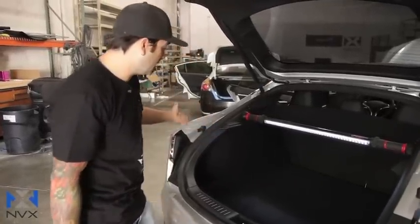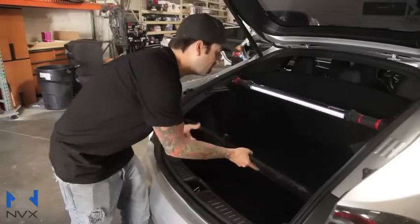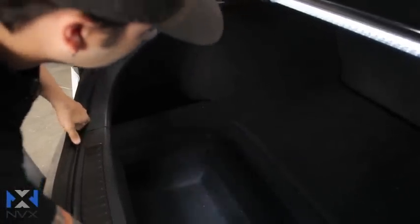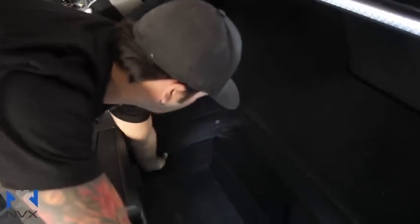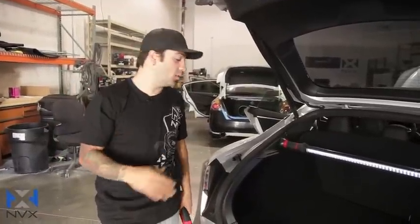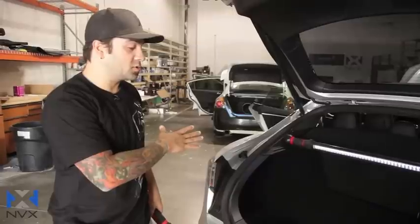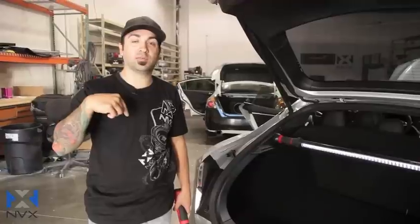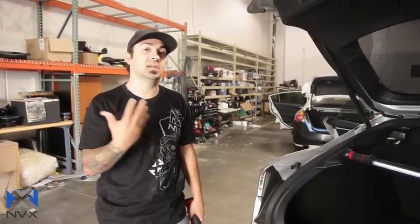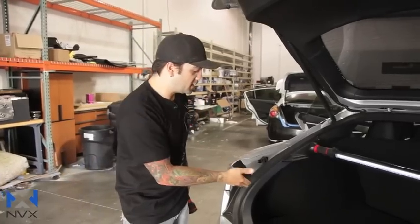We're here in the back of the 85D. Just to show you the car is exactly the same on the backside, we'll go ahead and remove this cover so you can get a better idea of the cubby hole. As you can see, we still have our standard cubby that will house the boost enclosure nicely. Right below it you have an empty cavity — plenty of space — and this is where we're going to install the BDA 751 monoblock amplifier. A lot of people don't like screwing into sheet metal, so we're going to pull the OEM trunk liner up and cut a piece of half-inch MDF that will go in, with carpet over it, so we mount the amplifier into the MDF instead of the car body.